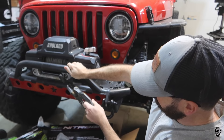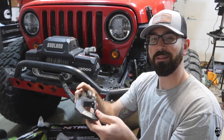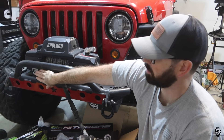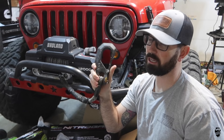One of my favorite things about this winch is the hook that comes with it. This hook is absolutely amazing — it's almost three years old, a little bit rusty, and still operates beautifully, no bends. I much prefer having this big beefy hook. I can just slam it onto the end of a recovery rope, a soft shackle, anything like that — quick and easy. I like that it's large and when I put it up against the fairlead it folds in and is basically flush, and the bull bar on this bumper sticks out a little farther, so it protects the whole bumper. This is a 3.8 size hook.